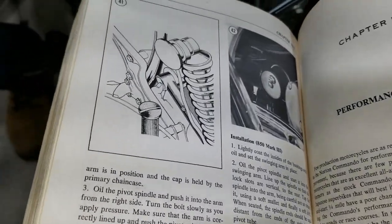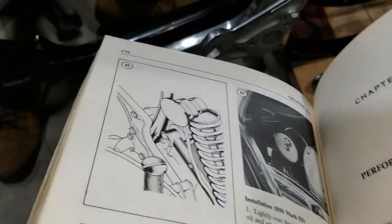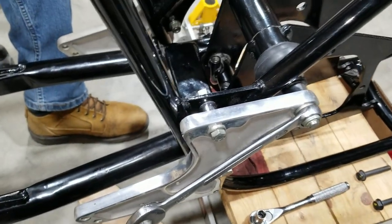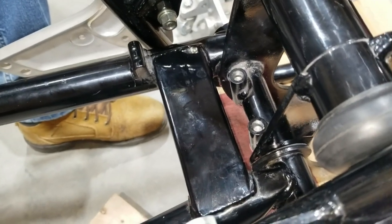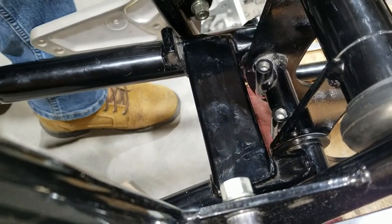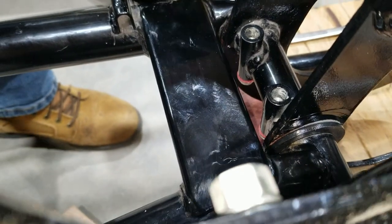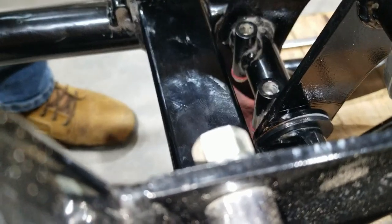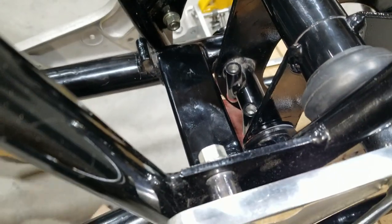It's like a 5/16 nut, so we'll probably just torque it down to quarter. Oh, it's quarter? No, quarter 28. Okay, quarter 28. That'd be about anywhere from 8 to 12 foot-pounds. I was going to say 10. We might put some inch-pounds on it, make them equal. You can see it from here, it's harder to see upside down, but it's the fiber washer, the steel washer, and then the nut. So we're going to torque it down to 12 foot-pounds.